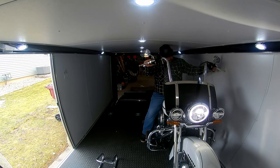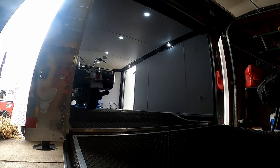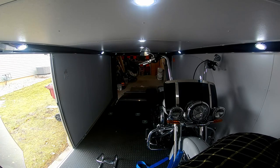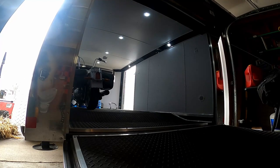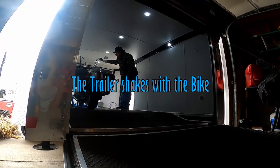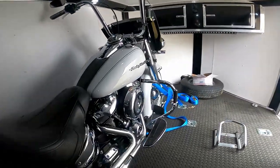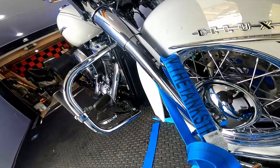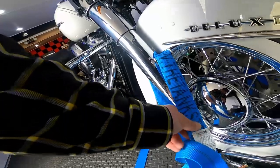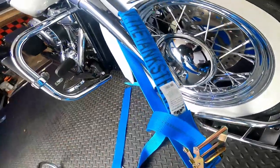Put your bikes in trailer mode also. The bike looks pretty straight — pretty straight up and down. I do have the front two straps on. The reason I strap through here is because I want unsprung weight, and these straps are not going to bend anything or scratch anything — they're soft and they're 11,000 pounds breaking strength. These will hold the bike no problem whatsoever.